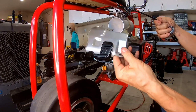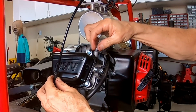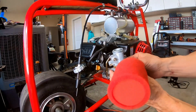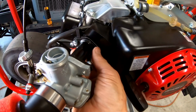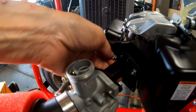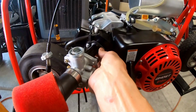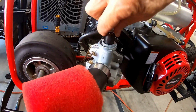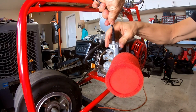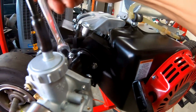All right. Install this plate they have on the Ghost. Might as well. So we'll put everything back on there. Go ahead and throw the insulator on here. Carb. All right, this thing going back together pretty easy. Now we'll see if it runs without breaking the tip off a valve for excessive valve spring pressure. We shall see. Put this slide back down in here. Header pipe and a spark plug, and I think we're good.